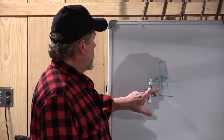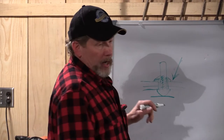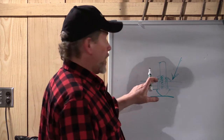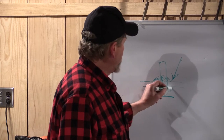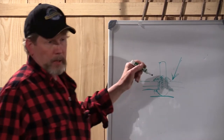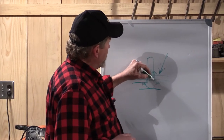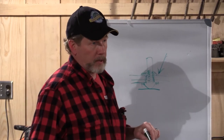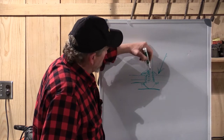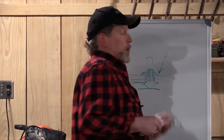Put pressure on the stack of plates to force them down against that rivet head. Put flux to it and solder it — not a lot of flux, because you don't want it dribbling through and coming out onto the visible surface. The solder will make its way down and fill the void. Once the joint is secured, you can cut the rivet off, shear it, and use your Dremel to round or grind it off.